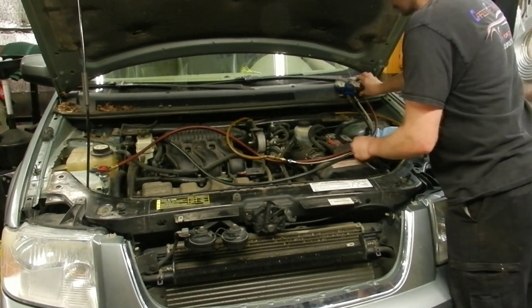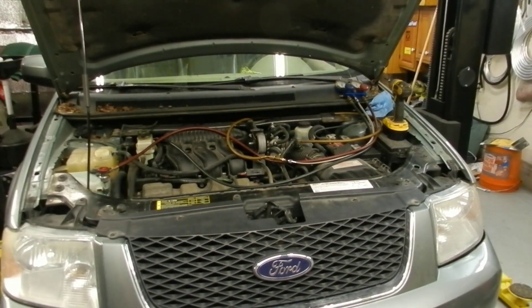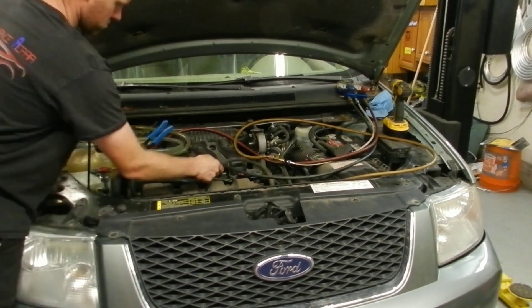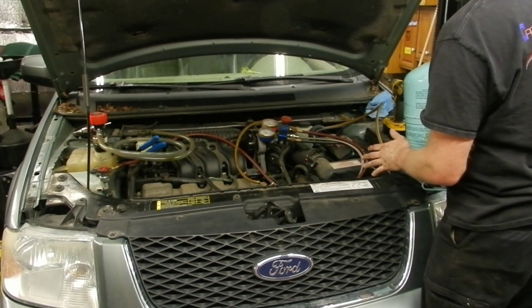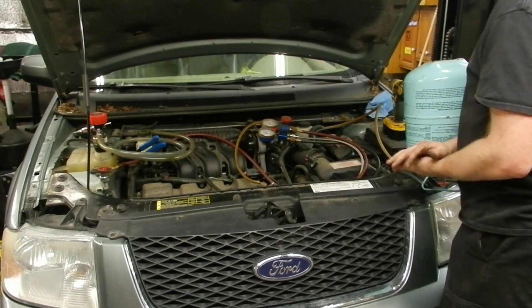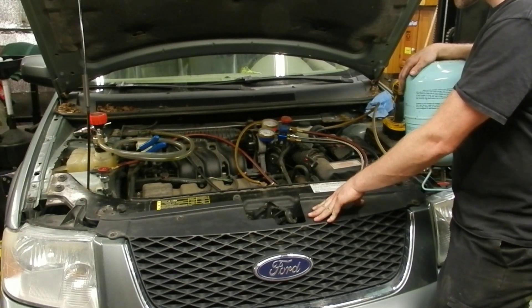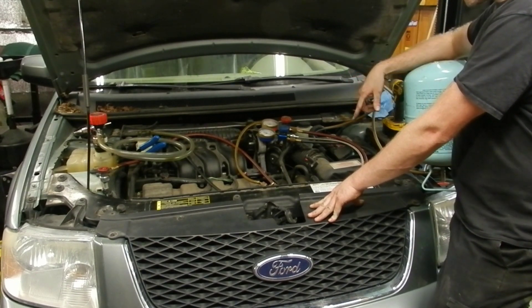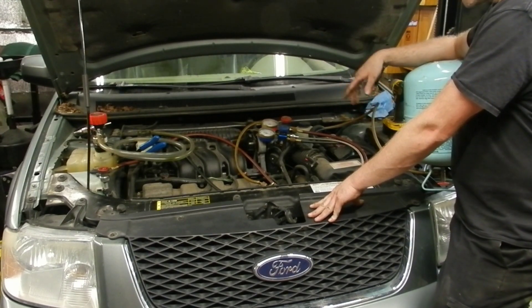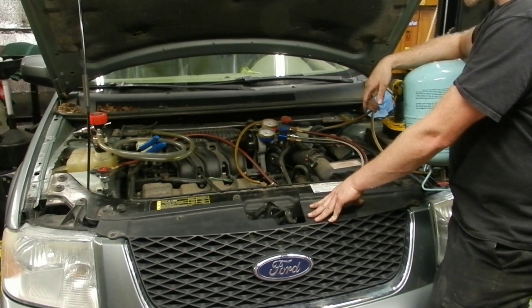It feels good to have a little more room back — I was able to push the car back now that I have the bottom half buttoned up. The last time I did this charging, I actually charged without using a scale. I based it off of pressures and heated up the charge tank — or the recovery tank in this case — just enough to make sure it's got more pressure than the rest of the system. I put the stuff in there, took an estimated guess as to how much I needed, and it ended up absolutely perfect. I left the gauges on, ran the vehicle, and didn't have to add or remove any. I'm going to attempt the same thing this time, and if it works out good, I'll continue doing it from now on because it just works so well.